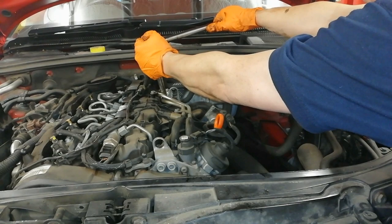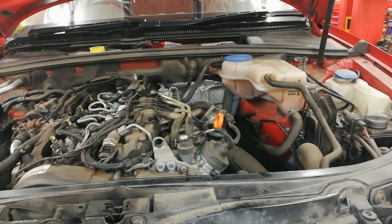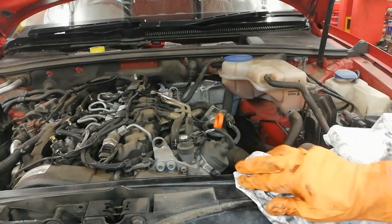It's supposed to be 25 Newton metres. That can be a wee bit misleading, but you need to feel the ratchet whenever you're putting it in. Any resistance and you know you're either cross-threaded or something's wrong — maybe you have the wrong filter, it's too long, and it's not going to go in correctly.